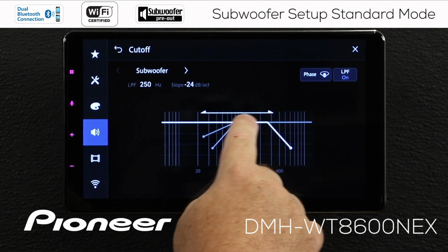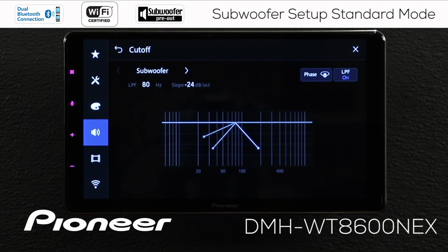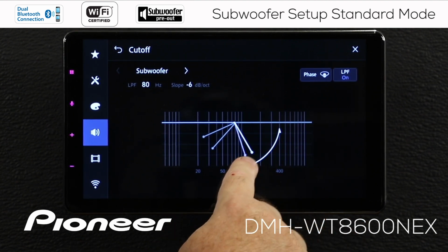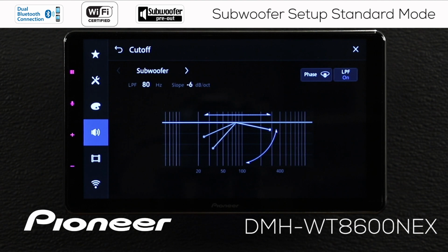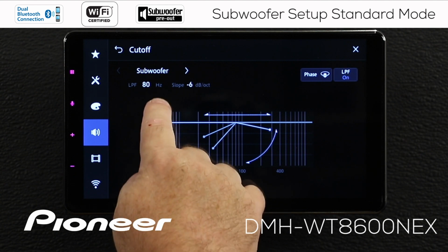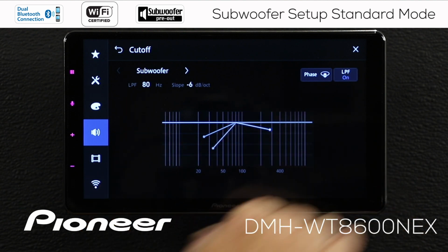So I'm going to change this back to, let's say, 80 Hertz for right now. There's 63, there's 80, and let's adjust the slope now. With the slope, I can choose between 6 decibels per octave and all the way up to 36 decibels per octave. So the slope is how quickly the sound rolls off, or the volume of the subwoofer rolls off. So everything that is above our crossover point, right now our crossover point is 80 Hertz, everything above that is going to be played more quietly. And here is our slope set at 6 decibels per octave, and that means 1 octave higher than 80 Hertz, the sound from the subwoofer will be 6 decibels less.